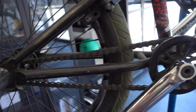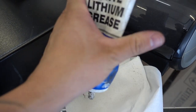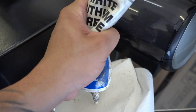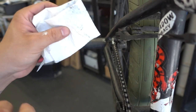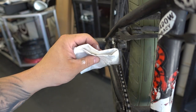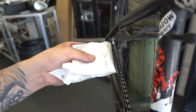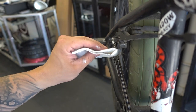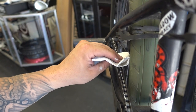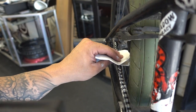So I'm going to show you how to do that now. There are a lot of different ways to keep your chain nice and lubed. My preferred method is to apply a little bit of lithium grease, which is a little thinner than other grease. Just put it on a little napkin, and take this as a precautionary note — you're going to want to backpedal. You don't want to pedal forward. I've seen a lot of people get their hand caught on the sprocket and it mangles up your hand, so you don't want to do that. So just lightly apply the napkin, backpedal, make sure that you're on top of the chain so you can't get caught on the other side of it.